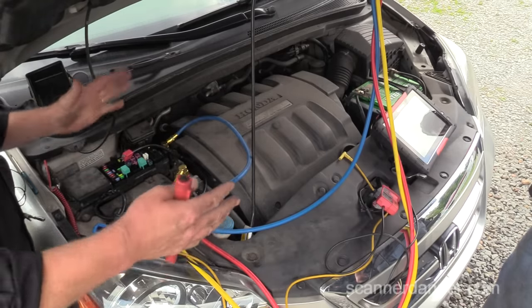I'm going to take one voltage measurement on this harness up by the radiator and that'll be my final check. There is a connector right there on the fan side — that's where I'm going to do my measurement. That's a place that could be corroded. I need to do a voltage measurement on the far side of that connector to make sure it isn't bad. And then after that, we'll put a clutch in it.